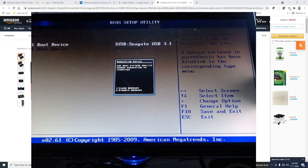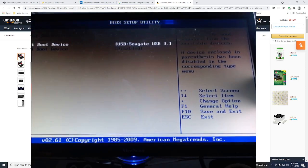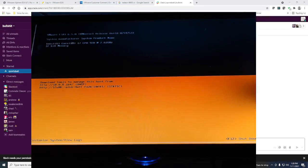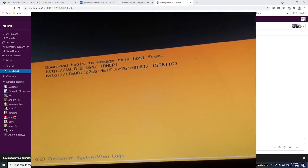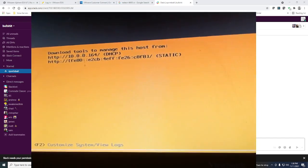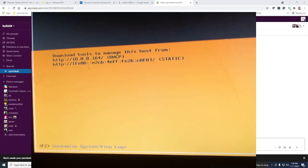Quick note: you might want to go into BIOS and set the correct disc for boot. I installed it on a Seagate USB drive — that one gigabyte drive — so I have that as first priority. You might have to do something like that too. That is a good sign — you can see 'Loading VMware Hypervisor'. Made it through the first loading sequence and on to the beautiful yellow and grey screen. You can see it worked, and it actually picked up an IP address at 10.0.0.164 from DHCP.